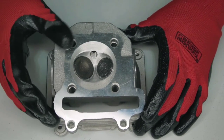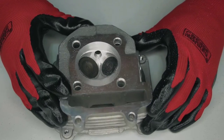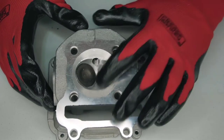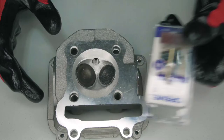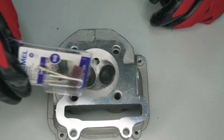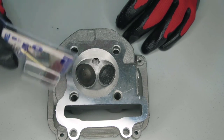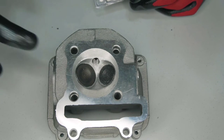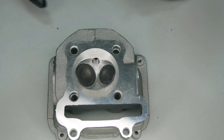As you can see, I didn't remove a lot of material out of the cylinder head — I just smoothed out the edges. After doing that, I'm going to sand it down with this disc right here to make the edges smooth, and I'm also going to polish everything so that oil deposits don't get stuck to the cylinder head.